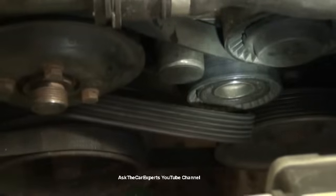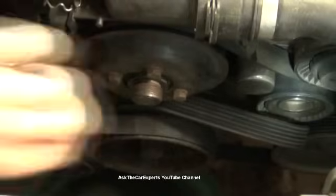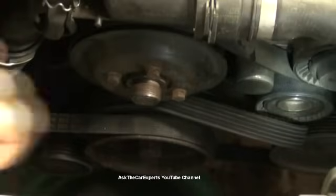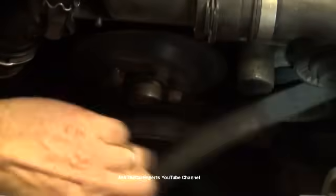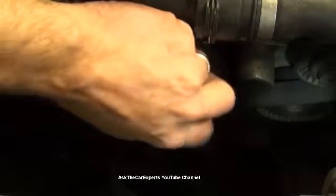That's all I really need to do to replace, if I was going to do this guy here, but you can hear that bearing is bad, or to access my water pump. I just have to let the belt sit there. I don't have to take it fully off. So now all I have to do is remove these four right here. Take the belt off of that and just put it down to the side.